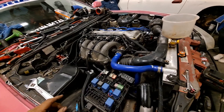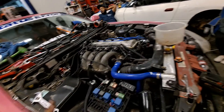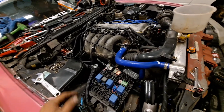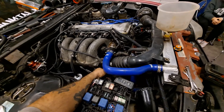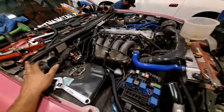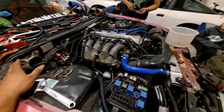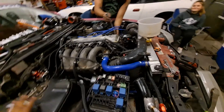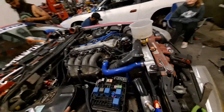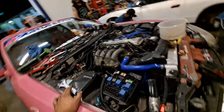Possibility I might have timed it wrong — that's my first time doing an S14 dizzy. S14 distributors have an internal coil so they're timed a little differently from the way you put them in. Apparently I put it in 180 degrees out. I'm used to S13s that I've timed a million times. So I put the distributor in wrong — that's why it wasn't starting, and why there was that backfire the first time. Technically at this point it should fire, so here we go.